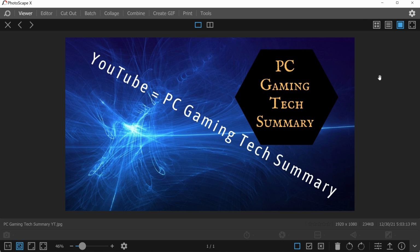If I'm looking at wattage, then I would look at it sometimes with VSync on, because what that does is it allows your graphics card to take a break, basically. So I've got 4K gaming with a 60 hertz monitor. So the maximum frames per second I need are 60 frames per second. So by turning VSync on, that will limit the FPS to 60.